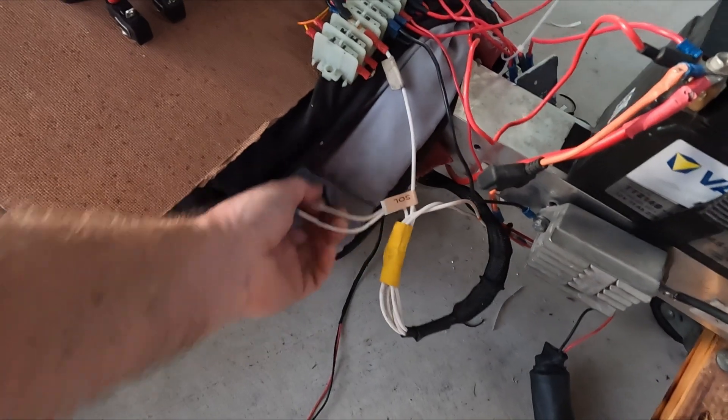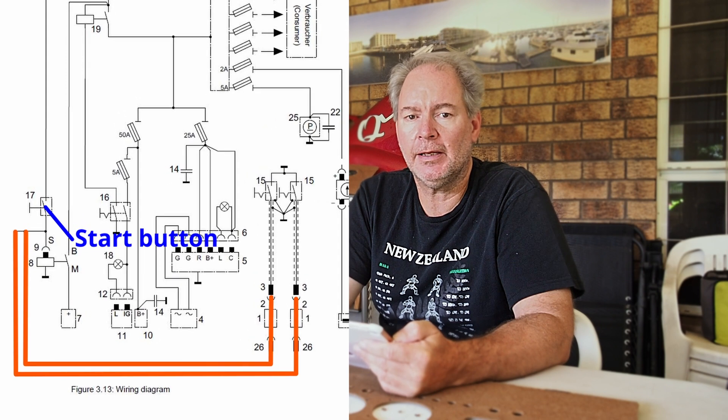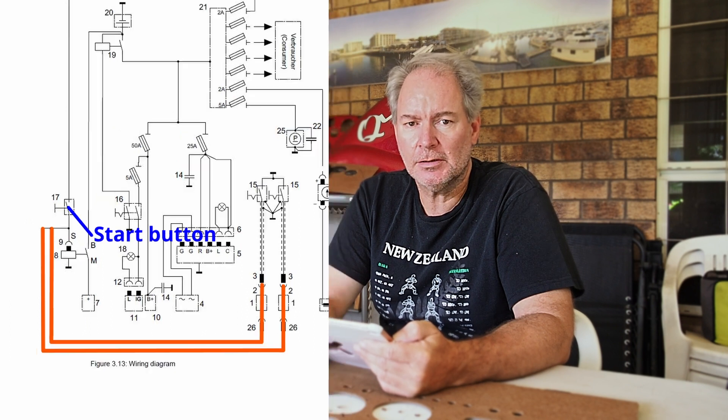In the last episode we looked at a couple of leftover wires - those two mystery wires. I did find out what they were: they were soft-start wires. That means the engine RPM is kept to a minimum for about five seconds. It's a Rotax system on the newer engines, and this engine includes it. With those wires connected, the engine will not fire up to full RPM for about five seconds, and then once it has established inertia, momentum, and stabilized, it automatically goes to normal operating RPM at idle.